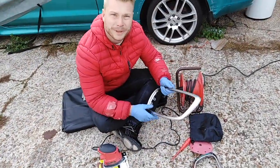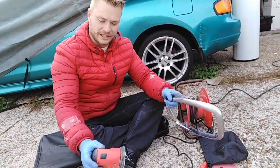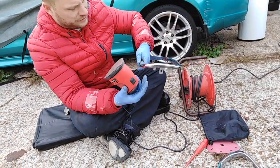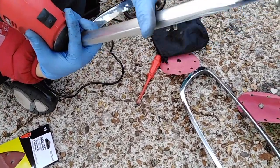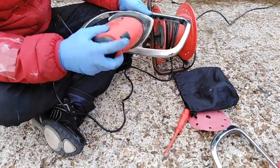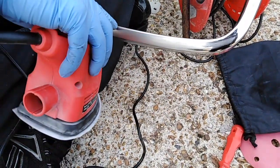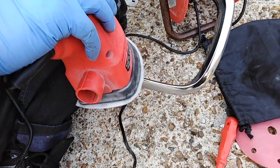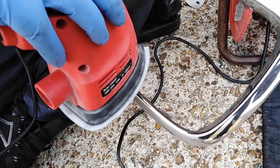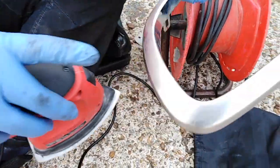This is good German engineering - the grill is quite tough so you can't sand it down by hand. Get yourself a palm sander for about 10 quid. We're using 125 grade. You just want to take off the shininess, make it quite matte so you can lay a layer of primer and then paint it. Use the flat bit, and where you have chips, rub it against the chip for a while and the chip will come off eventually. Carry on until it's all matte like this.